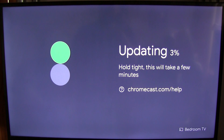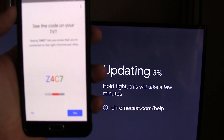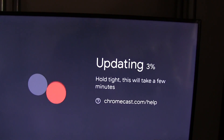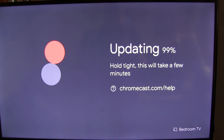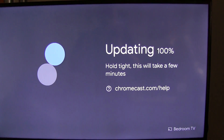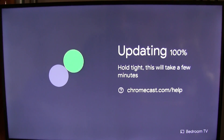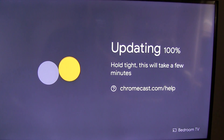So it's stuck on that page for a while — then a long while. It wasn't updating at all, so I tried to start again. I tried adding the device again with the smartphone and it gave me the four-digit code again, but the update page on the TV never changed. I gave up trying to do it this way, so I plugged a LAN cable into the Chromecast's charging ethernet port and the Chromecast started to update — finally some progress. But how is it supposed to connect wirelessly if it doesn't have my Wi-Fi password? There are no instructions or explanation on how things are supposed to work.